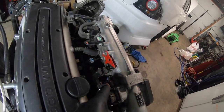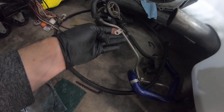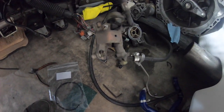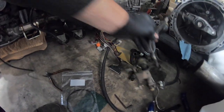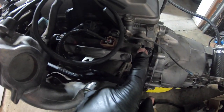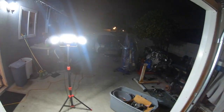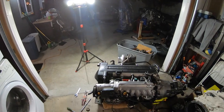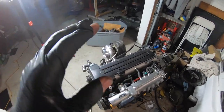One of the big things for me was there was a coolant pipe running in the intake, and we were able to take that out because we got rid of the coolant to the throttle body. We're also able to take this out — this is the fuel damper. What we did is we put an AN6 right in the back of the rail and we're going to do a 90 down and run AN fuel line. Right now I am going to throw this engine in the car. This engine's freaking beautiful — cleaned up beautifully, way less crowded, and most importantly it's going to be way easier to work on in the car.